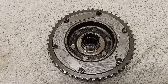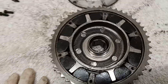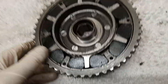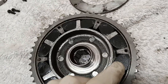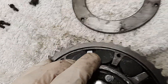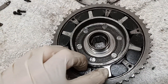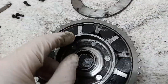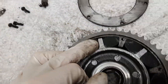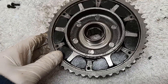We've undone the nuts and taken the cover plate off, revealing the rubbers underneath. The rubbers aren't in bad condition — they're not perfect. There are a few chips out of the corners, and what happens is that because there's so much pressure here, when the rubbers are compressed by the spider in the middle, the rubber squeezes underneath the vanes and gets damaged by them.